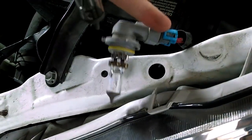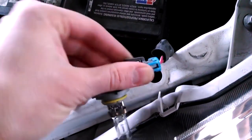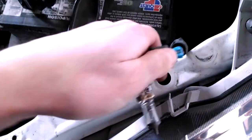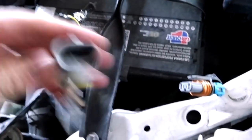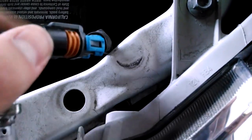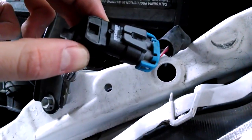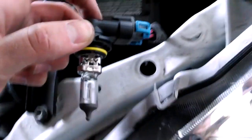Here's my replacement bulb that I ordered online. You can see what it comes with and where you'll need to disconnect it — disconnect the old one and put the new one on. It's blue on mine; I don't know what color yours will be. This gray part is where it clips off. I've loosened the back clamp just a little so I can wiggle it off. That clamp comes off and the new lamp just slides right onto the connector. You can see it's latched on — two little parts clip onto either side of the latch, securing it in place.